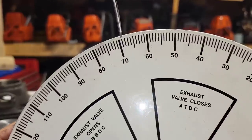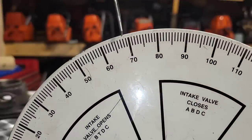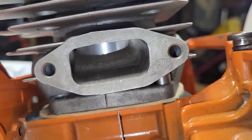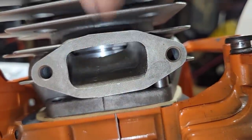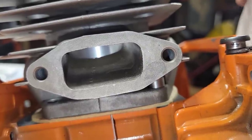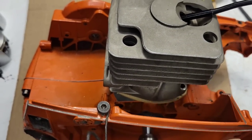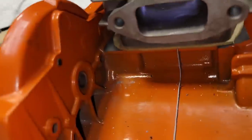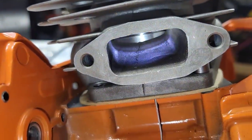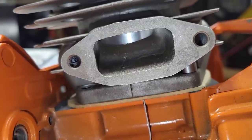If you're stopping your piston, make sure it stops in the same place and your wheel is zeroed. Next question: do I get a full rotation? Does it hit? Well, look at that — this thing doesn't hit at all. There's top dead center. Next, do we have free-porting on the exhaust port? Is there a gap at the bottom of the piston? No there isn't. This is all stuff you've got to think about when doing something like this. Now let's time it — I take my little scope, stick it in the spark plug hole, and look for the first ray of light.